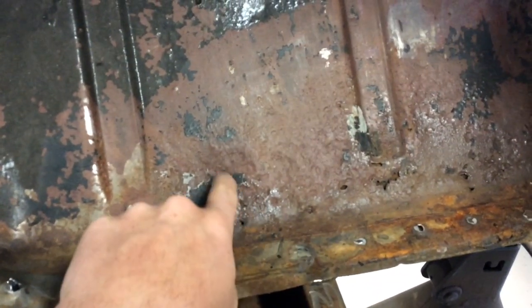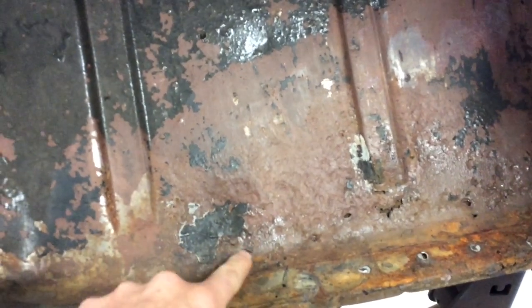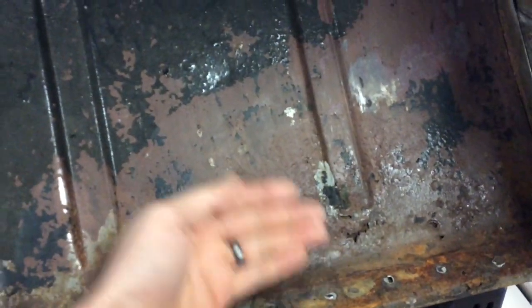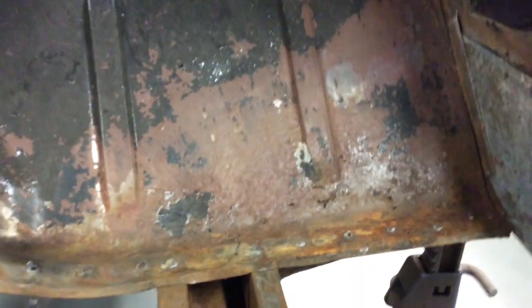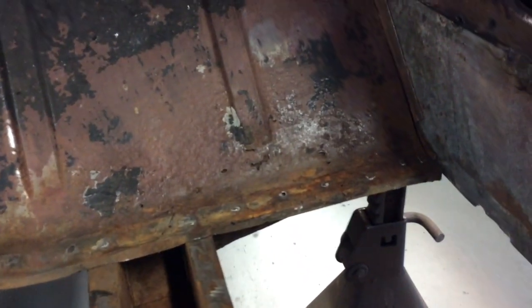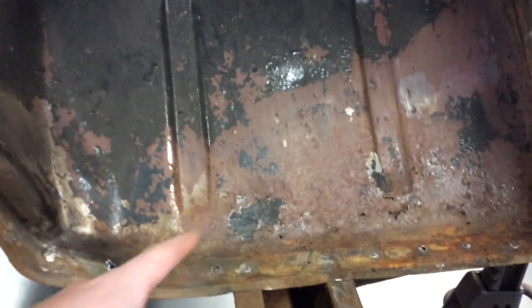I took my wire wheel and cleaned up along there just to find where it was clean. You can see the amount of pitting going on from that line that I did down — the pinhole is starting to go through there. There's a little bit of a space in between there; the torque box is right behind that, and that space just creates room for the rust to grow. So they commonly rot out there. I'm going to replace this side from that line — I've got to cut that out and patch that first.